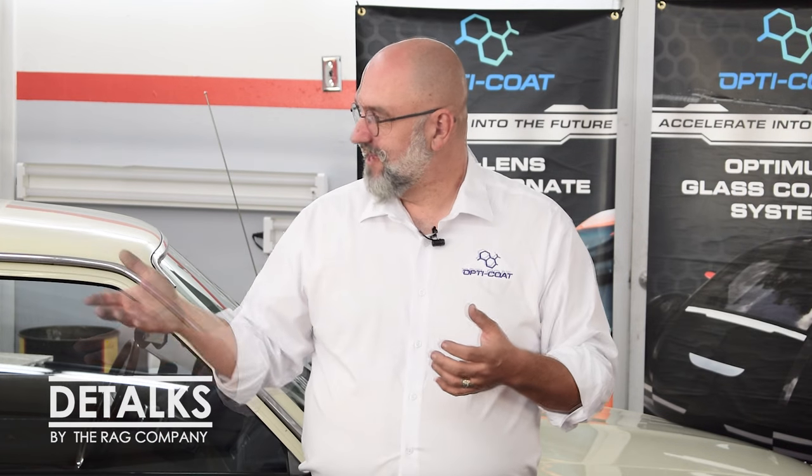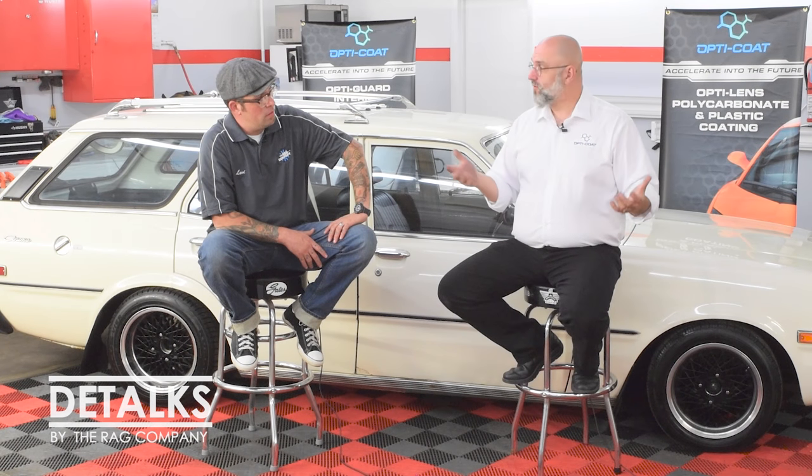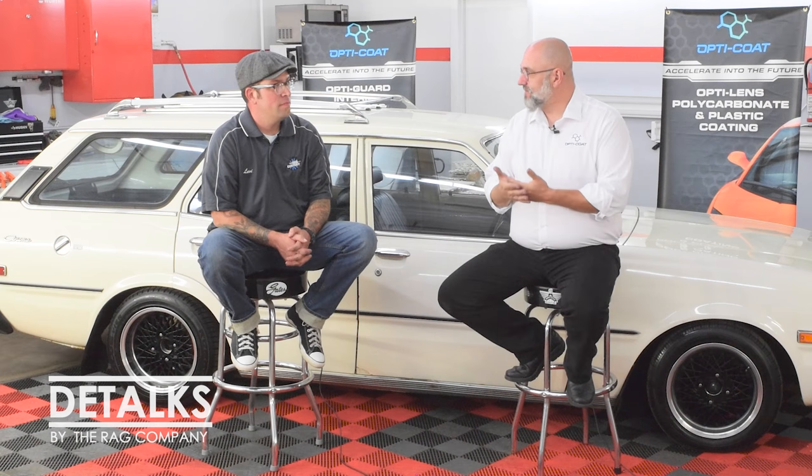We've all seen the car, the guy's finished, looks beautiful. Two or three weeks later, it's all full of buffer trails. And a lot of people have the reaction of saying, well, he used a glaze. No, he may not have used a glaze. He just heated the paint so much that it swelled. It didn't shrink back down immediately because now it was swelled up with Botox. It looked like some actress whose lips are full. So as those solvents work their way back out of the paint, those cracks open back up. And now we see those little swirl marks. So creating heat is a negative aspect of polishing.